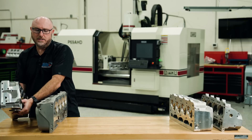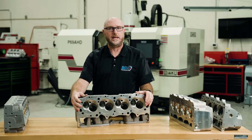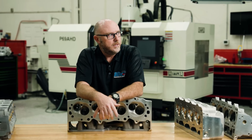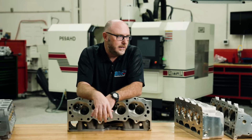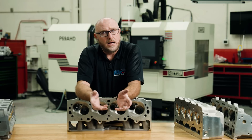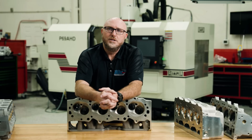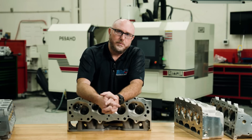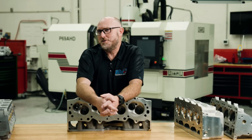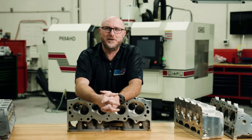What about a big block Chevy? This is a Brodix aftermarket big block Chevy SR20 head — the valve angles are different at 20 degrees, whereas a normal big block is something like 23 or 24 degrees. So when does that stop being a big block? In truck pull engines, they'll put Hemi Chevy cylinder heads on a big block, and everybody still calls those big block Chevys. So why is there so much hatred over the LS engine that people can't stand it when one runs good, and they have to do everything to say that's not an LS?